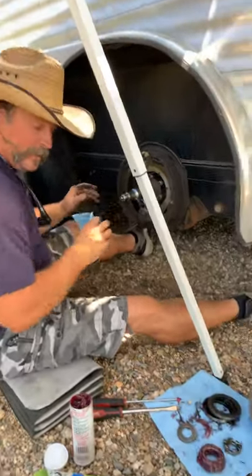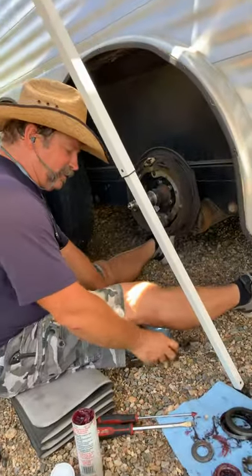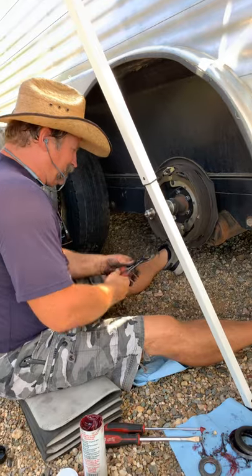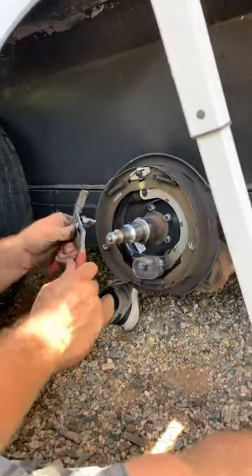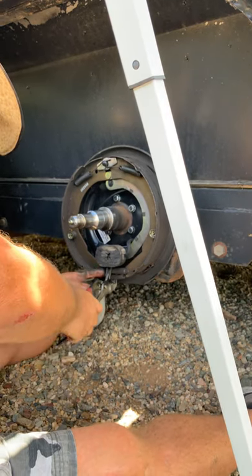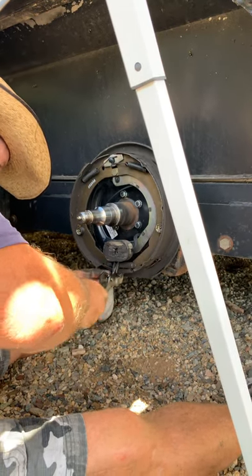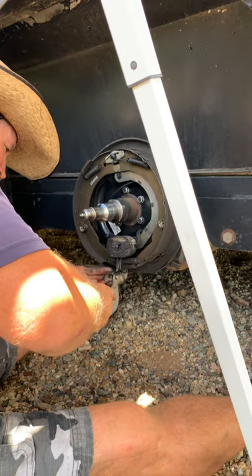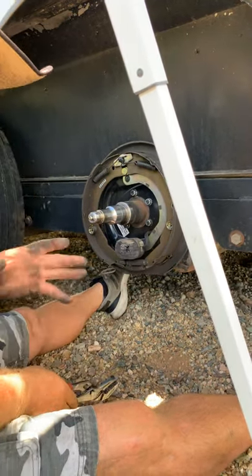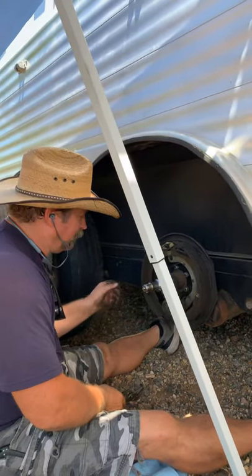I'm going to show you how I adjust these before I put the wheel back on. I've got a fused right knee so usually a tool will go right there on the ground and I'll be looking all over for it - that's where tools like to hide from me. I just adjust my channel locks down to about there, then you want to turn this and watch your threads - you want to see them opening up, not closing. I go about a turn and a half. If I need more, once I get the wheel put on I can come from the back side and use a brake adjuster to get the last part.